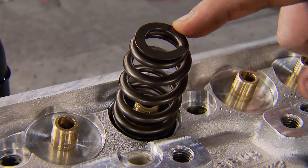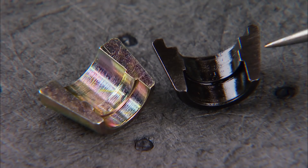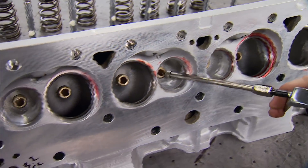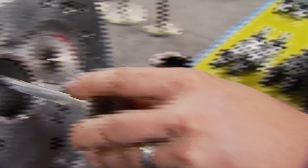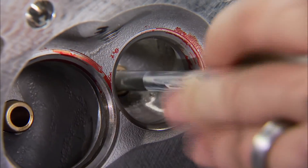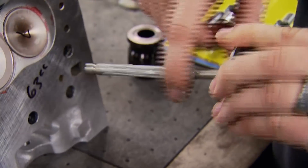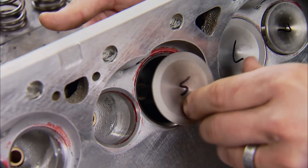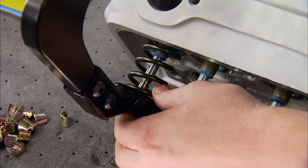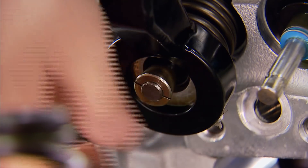When we install the locator, we're going to lose 50 thousandths on our install height, and we have a couple of options: machine the spring pad, do a valve job to sink the valve, or buy a new set of springs. This standard lock is what I use to check our install height. These locks from Comp will actually lower the lock but raise our install height 50 thousandths. I put a little oil in the guides and some grease on the valves to guarantee lubrication during fire-up. These valves also got bead-blasted and faced, and importantly, I numbered them to ensure they went back in the same hole they were lapped in. With locators in place, we install our seals, springs, retainers, and new corrected locks.